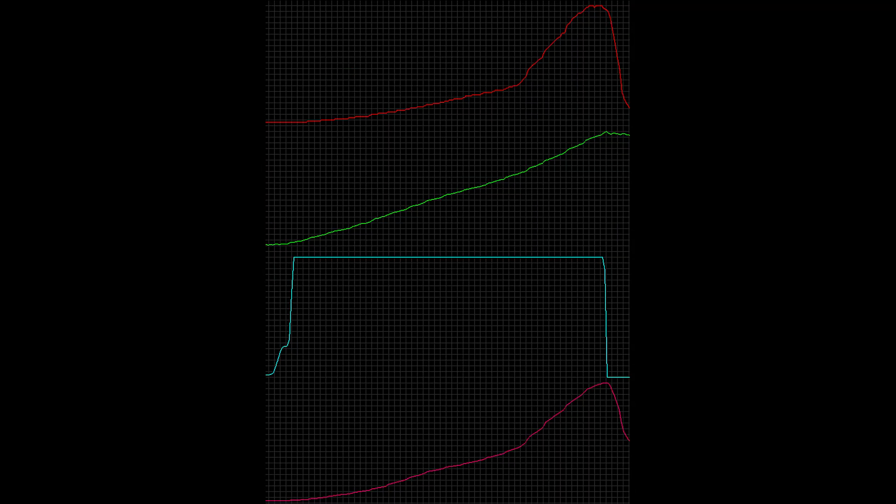Here's a quick look at the graph. With the accelerator pedal pressed to the floor, the boost is completely flat at low RPMs and only wakes up at the top end. It's clear this turbocharger needs to be replaced, so let's get on with the swap.